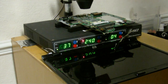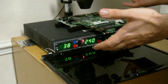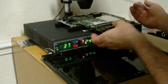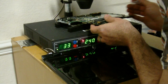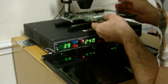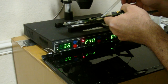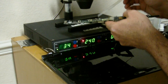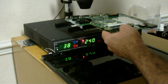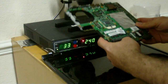We're over at the rework station. The reason I've got the screen here is they actually soldered one of the connections from the webcam into the board — kind of silly, but I guess they gave up on it. Right now I'm putting some liquid flux under the chip. Maybe you guys can see my liquid flux — it's alcohol-based and that's a no-mess flux. I just do it until I see it peak out on the other side, rocking it back and forth. This ensures I get a good flow.